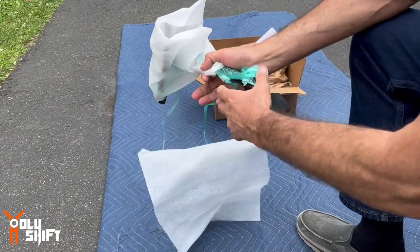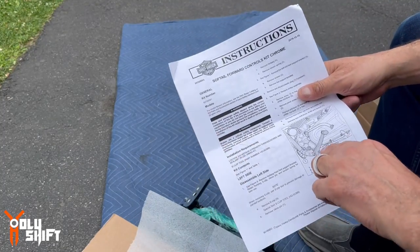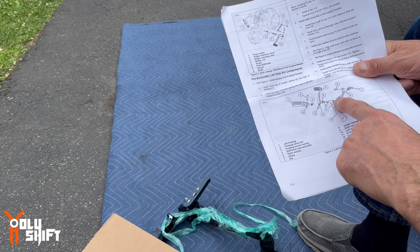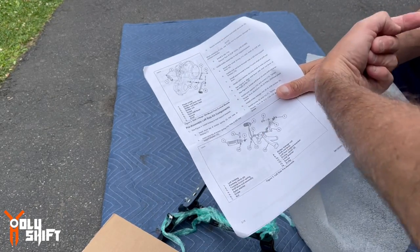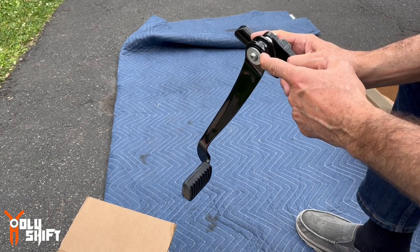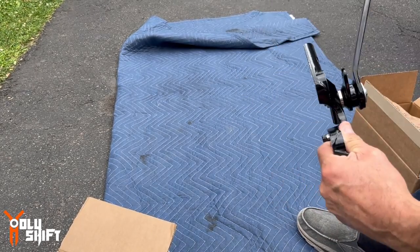These are after being powder coated — they were chrome originally. Before mounting, I followed the provided Harley instructions to pre-assemble the parts. It comes in pieces, so I used the diagram and put the proper levers, bolts, o-rings, and pieces together. I pre-assembled each side at home so the install on the bike will be much easier. That's the brake side. I put the main bolt, the washer, the large o-ring with the bolt inside, and the lever in, with the nut on the other side — to be installed on the right.